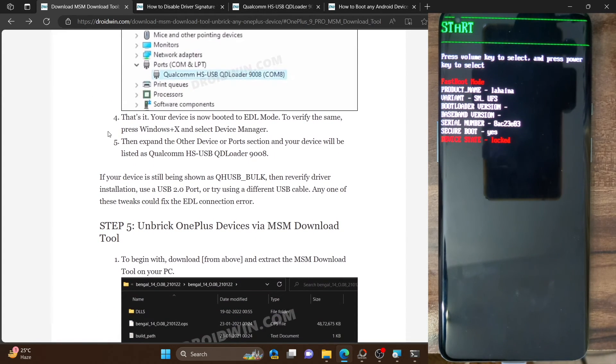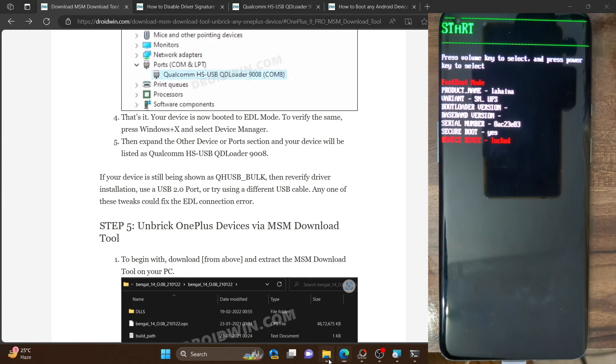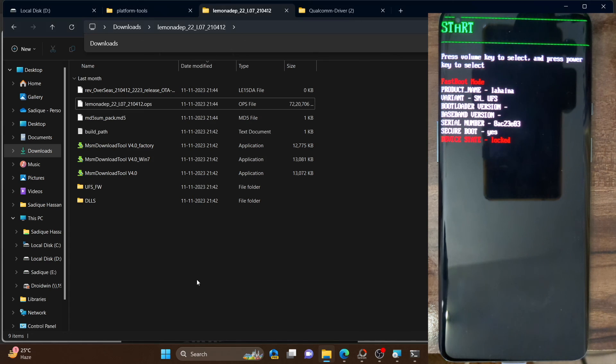To wrap up, one of the biggest real-world advantages of this method: I once messed up a flash and the OEM unlock toggle was still disabled with the bootloader locked. Even though I could access fastboot mode, I was unable to unlock the bootloader because OEM unlock was turned off. If you are ever stuck in fastboot or a boot loop with OEM unlock turned off, you cannot unlock the bootloader through normal means — so you can use the MSM tool to flash the OPS firmware and your phone will be up and running again. Note: you can only flash the OPS firmware this way, not a fastboot ROM or any other firmware type with a locked bootloader. Thanks for watching!